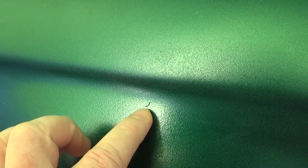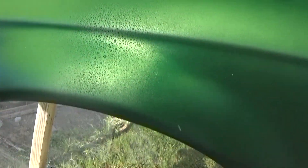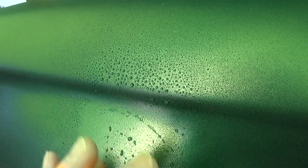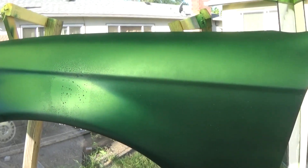This is probably some very fine dust — you can't see it, but when I wet sanded it, it got rid of the little bump. You can see gray coming through from the primer, but I just need to wet sand it one more time. All you do with wet sanding is squirt some water on it and on your pad, then just gently go over it — it'll come right off. You can use your finger a lot to feel the progress you're making.